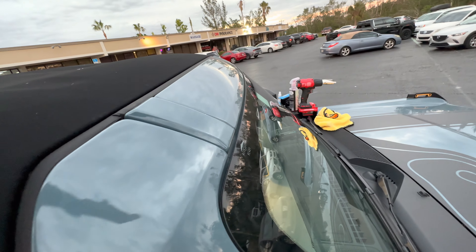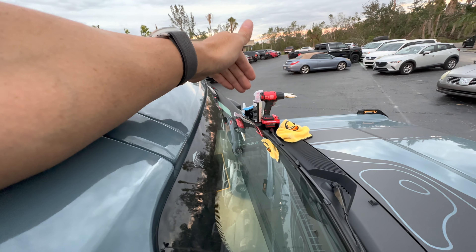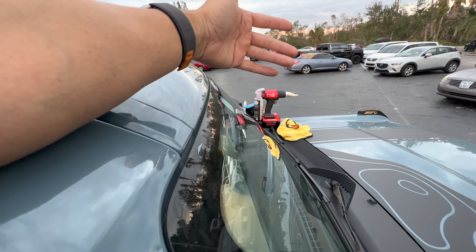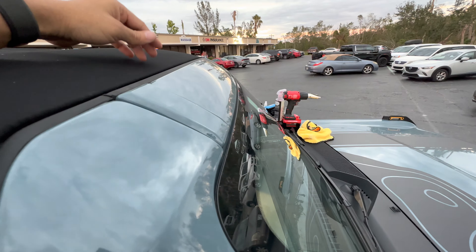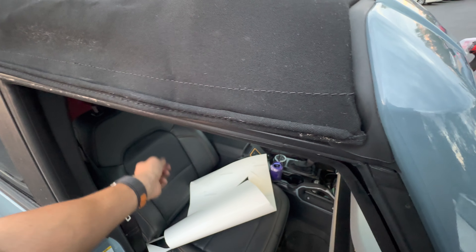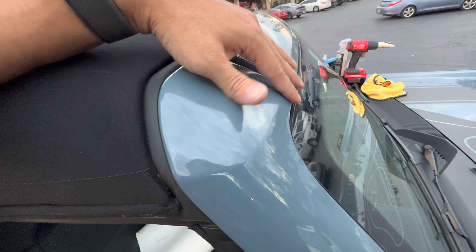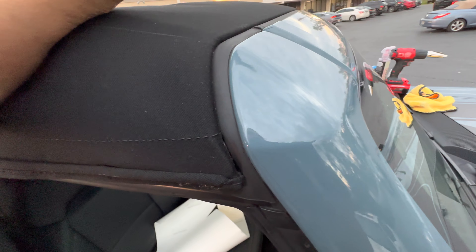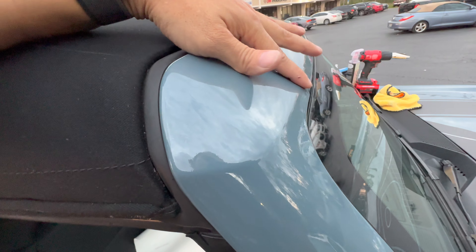Then I had to use very light heat. The heat gun I use has a battery — it is a cordless heat gun but it outputs very, very low heat, and that's why you want to use it on PPF. You don't need high amounts of heat. Any of the stickers we've installed, that thing is good enough. Keep a hairdryer around, keep anything around. For those of you with an AC port in the back, you can keep your vehicle on, use that AC port, use your hair dryer, or use a very small heat gun. Just apply light amounts of heat so you can stretch that over the edge. Light amounts of heat only — once you use too much heat, you've done it.